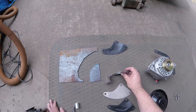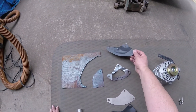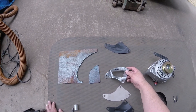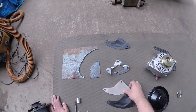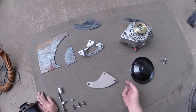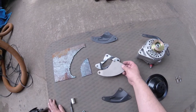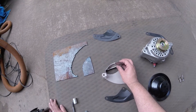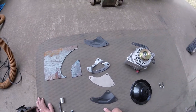A lot of heat was used, and it was also fabricated in a vise, so it's got a bend in it which strengthens the unit itself. Whereas the first piece was too flimsy, this is going to be a really good component — it'll last for years to come. Once it's painted you really couldn't even tell it's a hand-fabbed piece. Here's the cardboard template that was used. With the 45-degree bend it gives a lot of rigidity, and it's steel, so you can't go wrong.